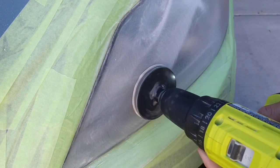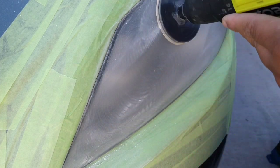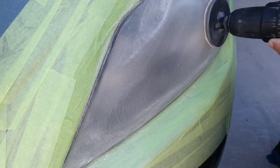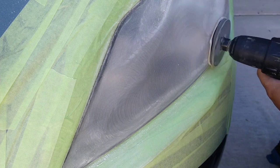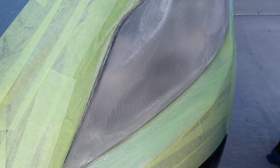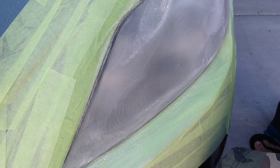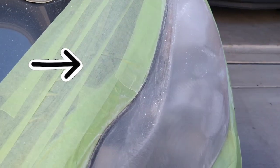You have to really keep a steady hand on this light — you're pretty much barely touching everything around the headlight. For certain lights like this I will tape off excessively, anywhere between four and seven layers of tape that butt up in the area where the light meets the bumper and surrounding car area, just to not damage the paint. I also did an excessive layering out, which is just one layer for precaution, because these lights have a propensity to throw the drill.